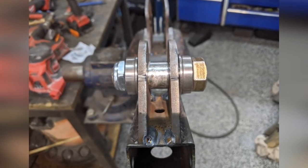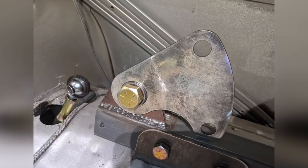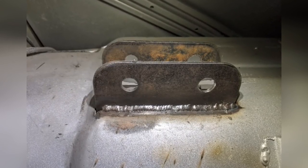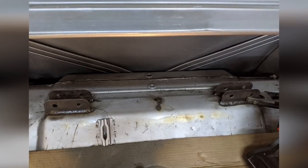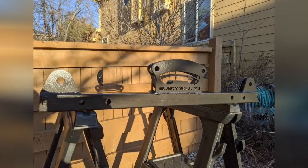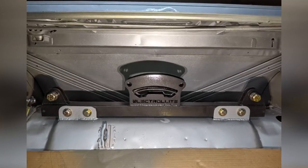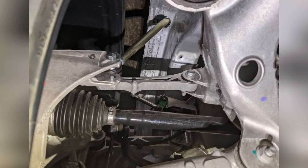Here's a closer look at the bearings with the spacer — these bearings are bolted straight to the ears, nice and secure, with the lip on the inside. I just slip the bell crank right over the edge of it, and when I bolt these to the shock and to the pushrod it holds everything securely in place. I might end up adding one more bolt in the middle. With everything figured out, I've got the tabs welded to the floor, adding strength just like a unibody car — welded to the floor as well as the frame, with a cross member top and bottom. This is a removable upper crossbar with the shock mounts in the middle and the tabs for the bell cranks on the end, held in with four bolts. Here it is in place, all painted up, bearings mounted, and my little Electrolyte logo in the middle — it's kind of a cross between the Tesla T and the bumper of the car.